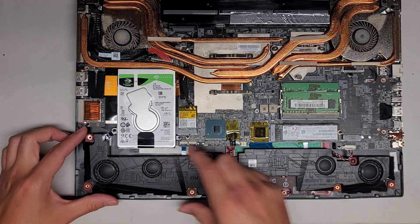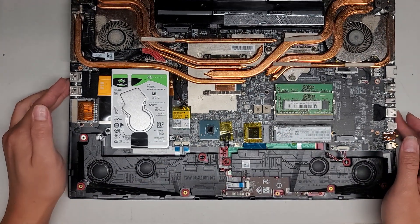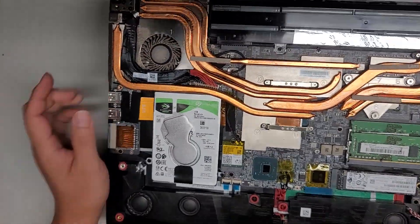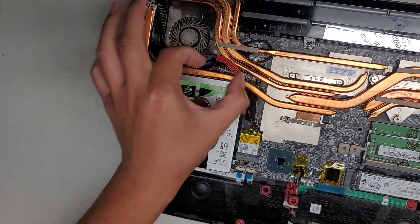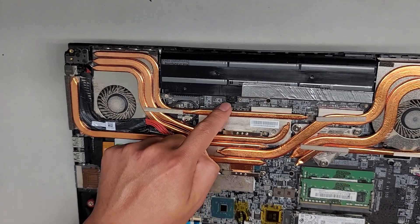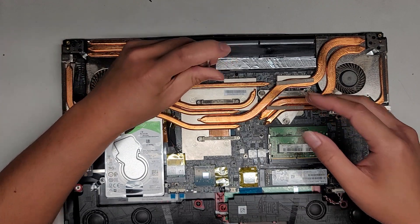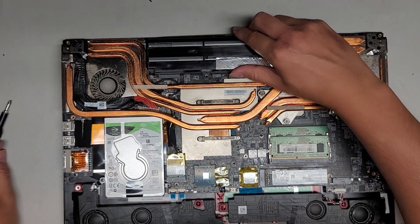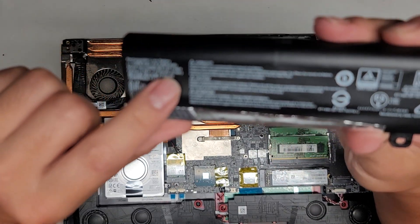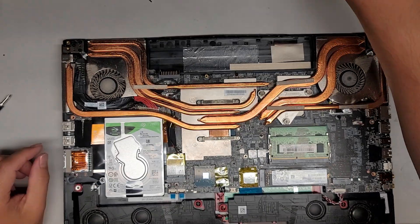These giant speakers are just held in with rubber, so there are no screws holding them down. This cable — you get the wings and wiggle it to pull it out. The GPU and CPU are soldered to the motherboard, so you can't really replace them. The DC jack is connected right here — it's a wiggle-pull connector. There are two fan connectors. The battery is right here with one screw. Once you take the screw out, you can flip it over. The battery model number is BTY-M6H.